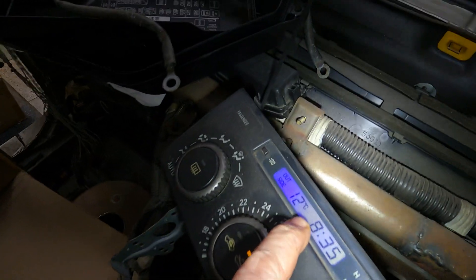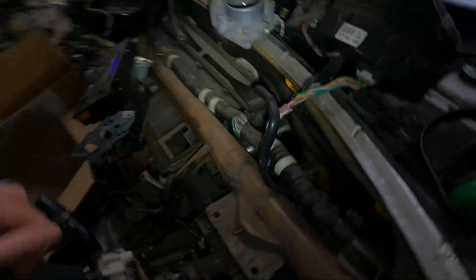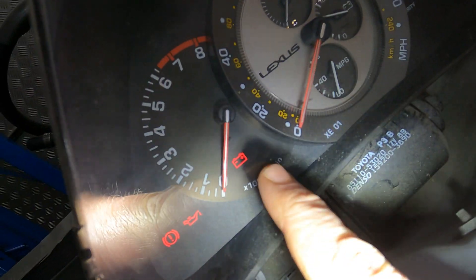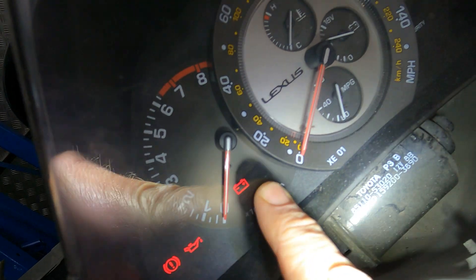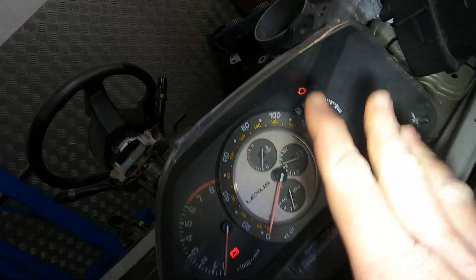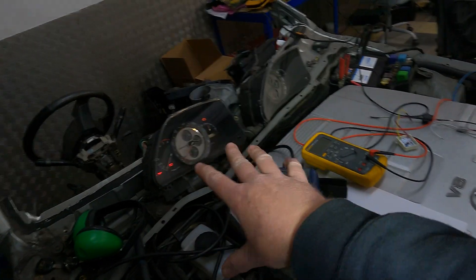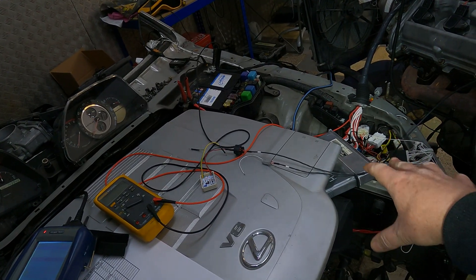So basically you'll see from here that we have got — obviously not applicable to you — but you'll see that the ambient temperature itself is working. You'll see that the coolant temp is working, the oil light's working, the charge light's working, and obviously the check engine light, but that's analog so it doesn't really matter. So all the information that's transmitted via MPX to the IS200 — that is all working and remapped on your ECU.